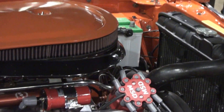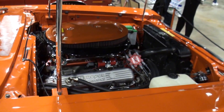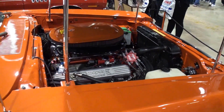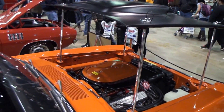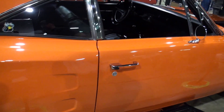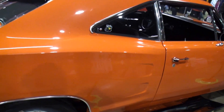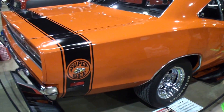This is an original 383 motor. It's a nostalgic build, as I would call it. It's got factory forged crank, factory forged rods, 30 over. It's got a lot of head work on it — an Indy set of heads, intake, and a 950 Holley. The motor puts out 450 horse at the crank. 450 horse — I get the feeling it moves okay. It gets out of the way.